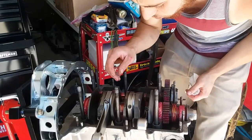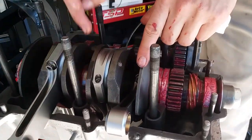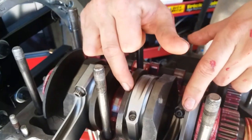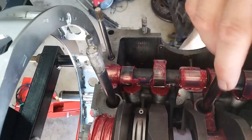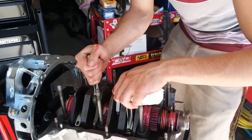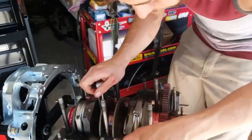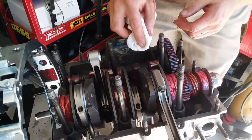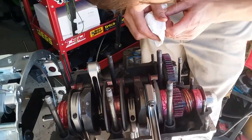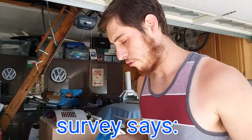What we've done is taken all the spots where it was hitting, or very close to hitting, between the cam and the crank, and marked them with black Sharpie. I'll decide what to do with those probably tomorrow - whether I'm just going to try and do it myself with a little hand clearancing, or take it somewhere to professionally do it. I'm kind of leaning towards the second option. I'm going to ask a couple of buddies some questions, get their input, and we'll go from there.